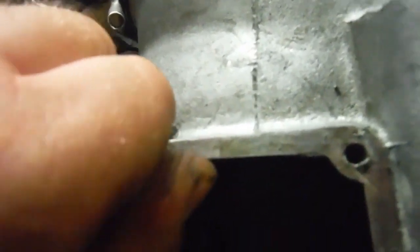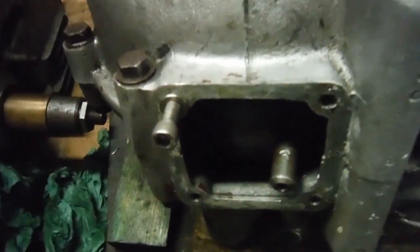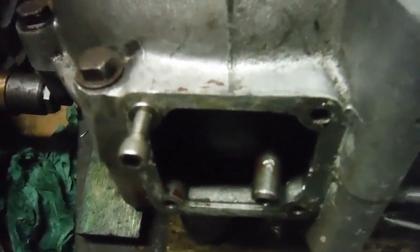The only thing I'll have to do is probably cut the bolt a little bit shorter so that it can pull up tight against the face of the sump plate and fasten it down tightly. But we've got a strong thread there again now, so I'm happy with that — that's well avoided the unthinkable, shall we say, and it's a pretty sound fix.